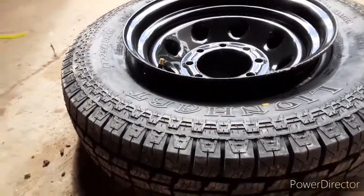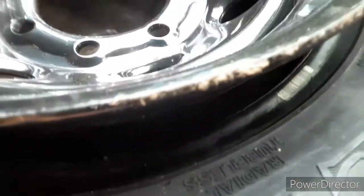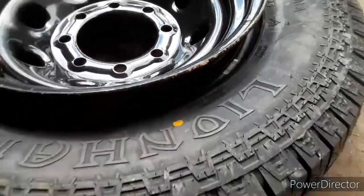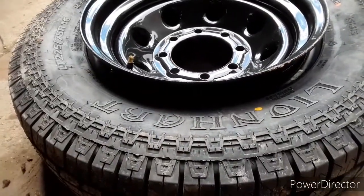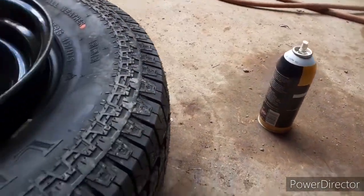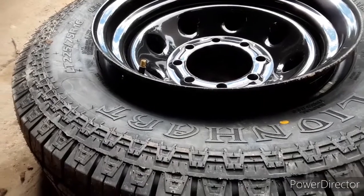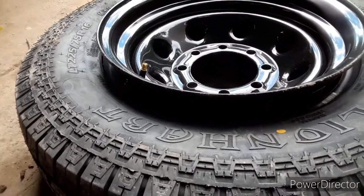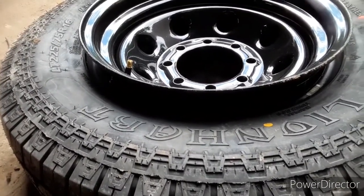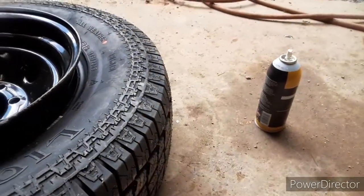What you're looking at today is a tire that's just about impossible to seat using conventional methods. So, some days you just gotta get the boom juice going. That's the only way this motherfucker is gonna seat, you know. You'd be fighting it for hours trying to ratchet strap that sucker in there, but you put the ether to it, usually about 3 seconds.